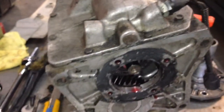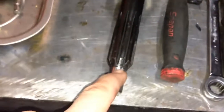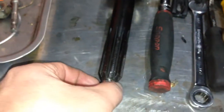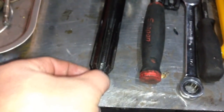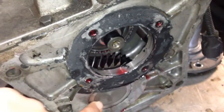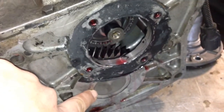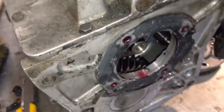That's the first thing to check. If the guy doesn't want you to check it, don't buy it. The other thing is four cylinders — the pilot snout here will be a lot, lot thinner. That's another way to check if it's a four cylinder or an eight cylinder, and the actual bearing right here holding the bearing on the front of the case — you have to make sure that looks just like that.